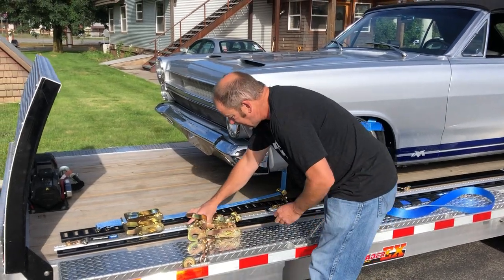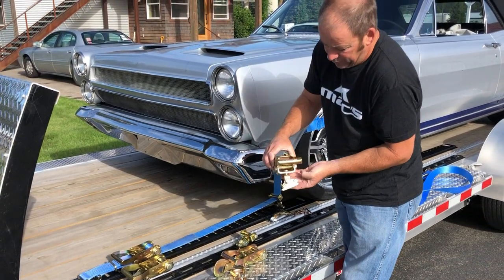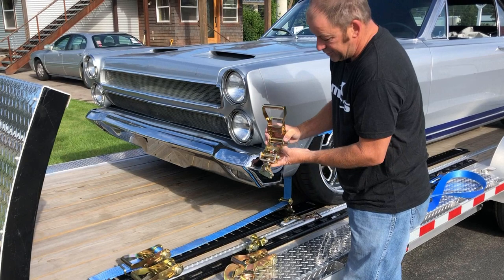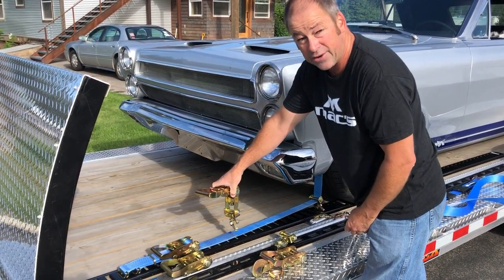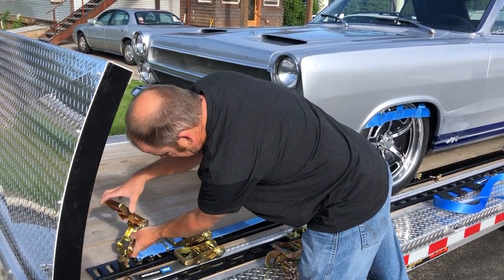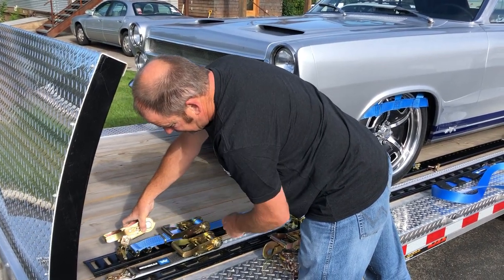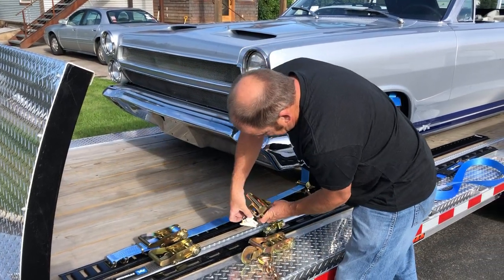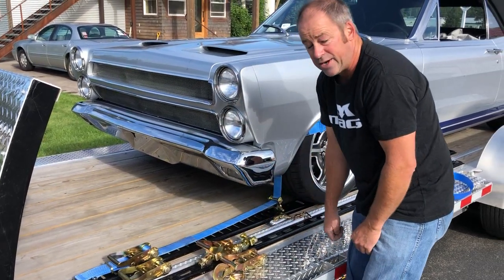For instance, if I take this fitting — which is an E-Track idler — and design it to couple straight to the ratchet, the only way that works for horizontal E-Track is if the ratchet is going to be standing relatively straight up and down. However, if we have an application that requires that ratchet to lay over, you can see all it's doing is attempting to bend the track right there.